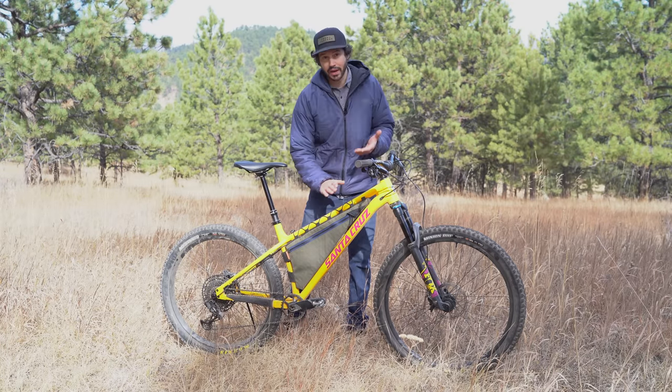The bike with pedals and the frame bag weighs 31.4 pounds. Just looking at the comments on Logan's review, this is a pretty expensive bike for what you get. As Logan mentioned, many bike brands are having challenging times with the pandemic, and that's likely why this bike is so expensive. Comparing it to the Salsa Timberjack, that XT build comes in at just over $2,000 and the GX build comes in at $2,500. Highlighting a few components: the bike comes with a Fox Rhythm 34, which in my opinion is actually a great fork, albeit a little heavy. It comes with an NX drivetrain — shifter, derailleur, and cassette — but the cassette is only an 11-50, not an 11-52. And the bike comes with a Descendant crank in the 32-tooth variety, but it can fit up to a 34-tooth chainring.